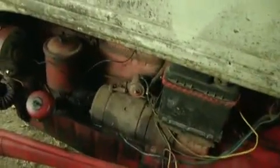I ran a wire straight to the positive on the battery, though you really should go through your amp meter so you can tell if it's actually charging or not. This alternator is a Delco one-wire alternator — I'm not sure if it's a 10SI exactly. You can find these at Advanced Auto Parts; just ask for their cheapest alternator and tell them it's not for a car. All the wires that went to the old generator you can basically get rid of.